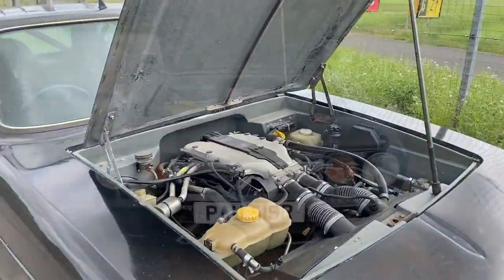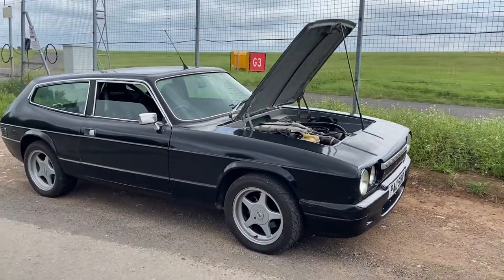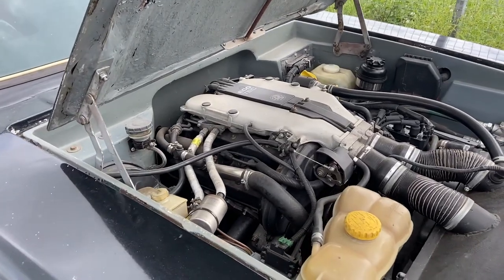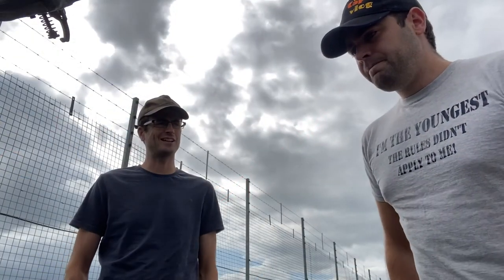On to the engine. The Scimitar originally came with a Ford Essex S6 V6, 3-litre. It was almost diesel-like but could still rev to five and a half to six thousand RPM, keeping torque all the way up. The factory rating was about 135 to 138 bhp, but typically they'd be under 120 — quite renowned for underperforming. For reference, that same Essex S6 V6 is now in a friend Pete's Capri, where it's been tuned for a race series.